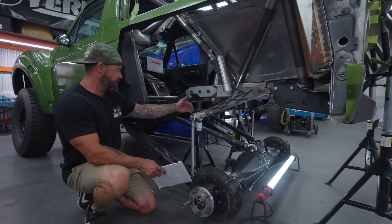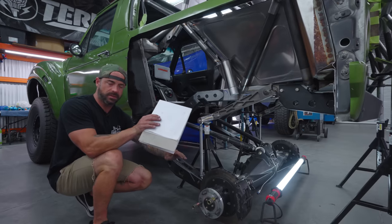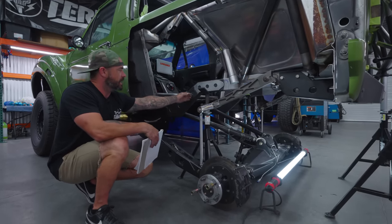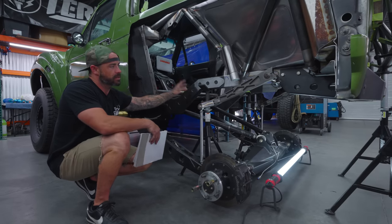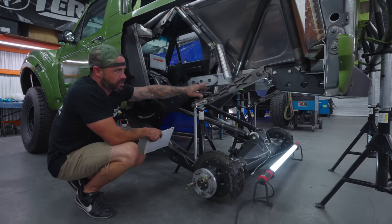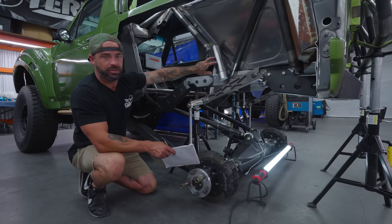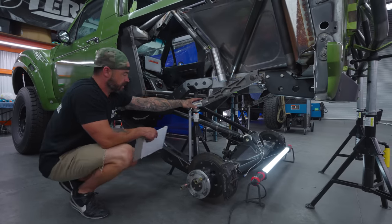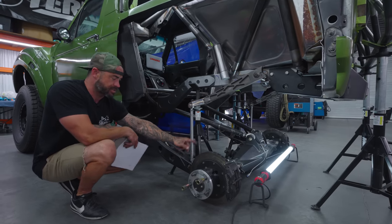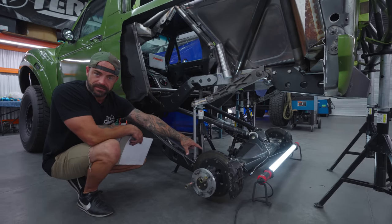The real constraint was the arm doing really wonky stuff to get around the shocks, and even when the axle swings — going up higher on one side — the shocks would clash into the sway bar arm. Now we have a more proper setup: a 74 weld arm, a proper inch-and-a-half bar, and it's tight — bolts are danger close to the bump can but that's okay. New sway bar tie rods, our classic signature strike pad on the axle where the bump stop makes contact, and new limit strap tabs off the back.